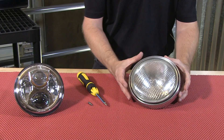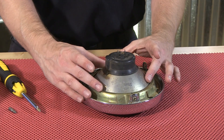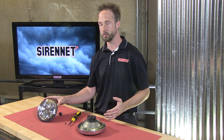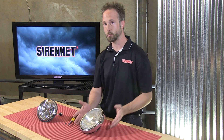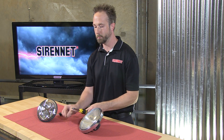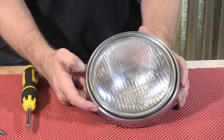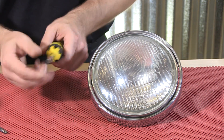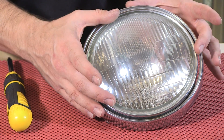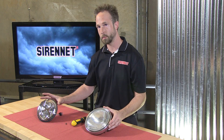So what I'm going to be doing here is disassembling the fixture. It's a matter of removing the outer trim ring, the inner trim ring, getting the incandescent housing out of the way, and then retrofitting in our JW Speaker product. In this case with our 1980 Kawasaki platform, all you need is a Phillips head screwdriver and two different bits for changing out the screws holding the assembly together. The first thing I am going to do is remove the front outer screw — this is actually the angle adjustment screw for the light fixture itself. With that being tied onto the actual bezel, we'll still be able to properly aim the LED upgrade.